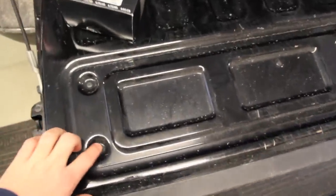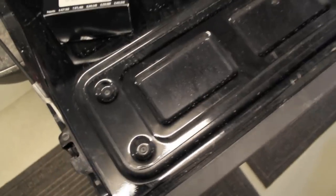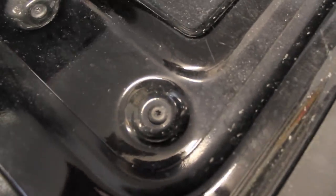For starters, you've got to get your tailgate back panel open, which is this part here. It's just about eight T15 Torx bits — I'm zooming in so you can see them. Go ahead and remove those and get that panel off.